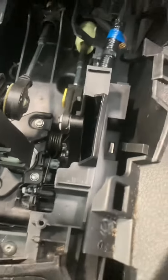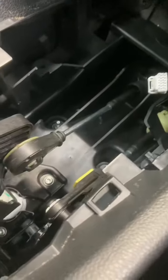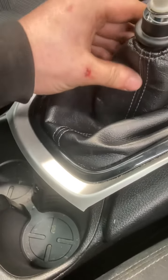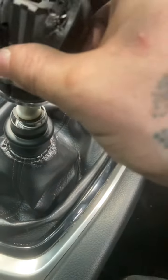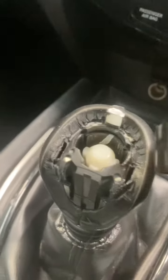Get them to locate — I need two hands for this one. We've got the two trimmers back on, the two screws back in, and the two torxes. Now I'm going to feed the gear stick through, just like that. I'm going to pop the handbrake cable back in. Now we've got all that in, put our gear stick back on and lock it into place with this pin.